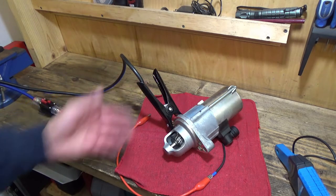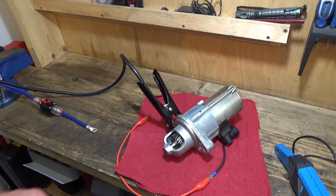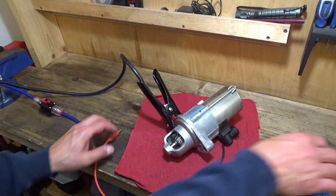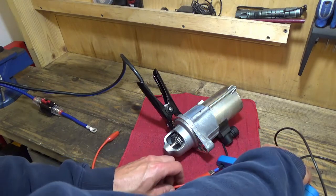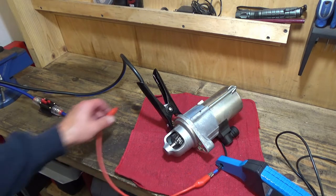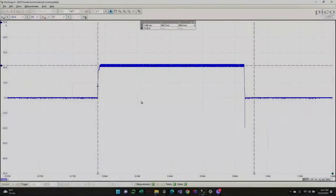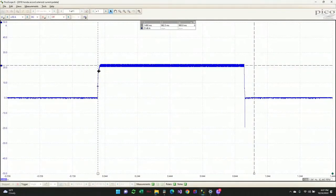I am using an old pair of jumper cables that I've repurposed, hooked up to a 12 volt battery. I do have a circuit breaker — 150 amps — in series with that for safety. If you're using a pair of jumper cables directly, just be mindful that there could be safety concerns if you short them out. I'm also going to throw a current clamp on there just out of curiosity to measure what the solenoid current is. As I short out this alligator clip, it'll energize the solenoid, and you see the pinion gear does get forced out as it's supposed to, indicating a good solenoid. It looks like it was about 21.5 amps of solenoid current. So now that we know that the solenoid is in good condition, let's get to the rebuild.